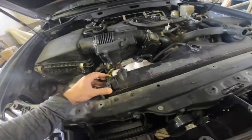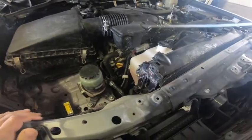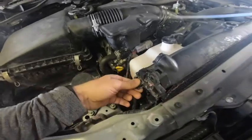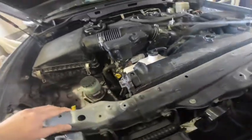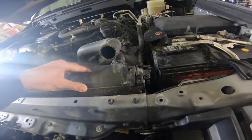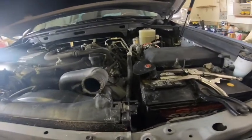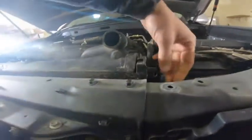One of the tricks is to leave this mounting bracket on the passenger side intact. So do not try to take this off. What you do is you actually take the radiator off the mounting bracket. However, on the driver's side, you will go ahead and remove the mounting screws. So there is one right down here,